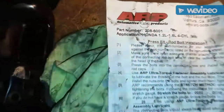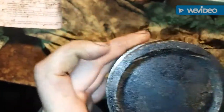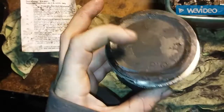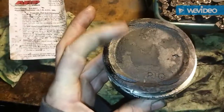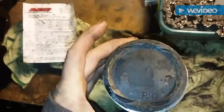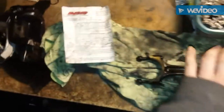Here's some information I forgot to add about the pistons and rod bolts. The rod bolts I'm using are ARP rod bolts, part number 208-6001 — B16/B18 ARP rod bolts. When you do your rings, you've got your piston pin, your top compression ring, second ring, oil ring and the two slots. Just check your factory manual — you don't want the gaps to line up.